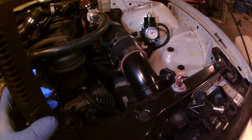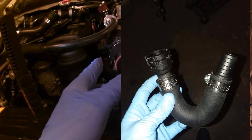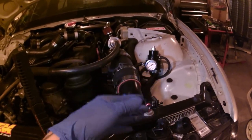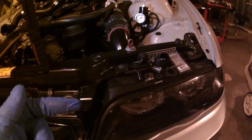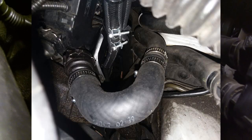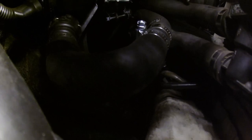To do that, I made this part using one of the stock plastic snap-on couplers. That snaps into the plastic hard hose coming out of the head. I cut the heater hose coming from the heater core, and that barb in that piece goes right into it. So we're using a stock fitting, and I got almost a 180-degree heater hose from AutoZone. That just conjoins the two. It's looped together — to the left is where it snaps on. The angle of that hose lined right up where I cut the heater hose. So that bypasses the expansion tank.